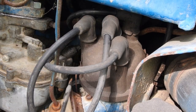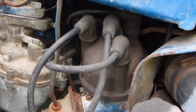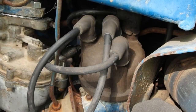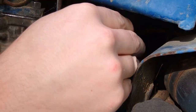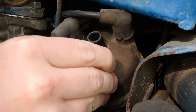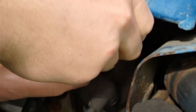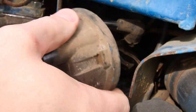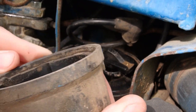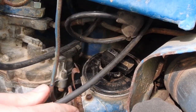First step, we've got to get the cap off. We're going to take our screwdriver and pop the clips. This one back in here — depending on how your distributor is positioned — is kind of hard to get to. It's easier to get it off than it is to get it on. You may have to deal with some plug wires. I had already had the coil wire off, but if you take wires off, just remember where they went. Now's a good time to take a look at your cap and rotor. This one's in decent shape — it's got a little bit of corrosion on it, but it's not too bad.